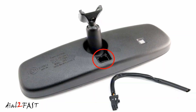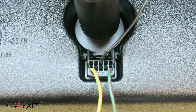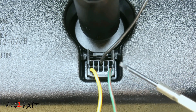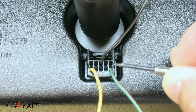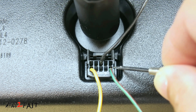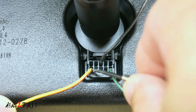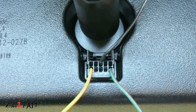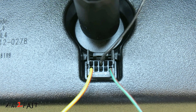For this type of mirror you need three wires: one ignition 12V, one constant 12V, and one ground. Here's the pin out on the connector. Pin 1 is the top right-hand corner, then pins 2 through 5, pin 6 at the bottom, then 7 through 10. Pin 6 — the green wire — is your ignition 12V. Note that wire color may differ depending on the vehicle it came from, but the pin will be ignition 12V. Pin 10, the yellow wire, is constant 12V. Pin 3, in the middle, is ground. Pin 8, just below pin 3, is also ground — some vehicles use pin 8 instead of pin 3, but both are ground.